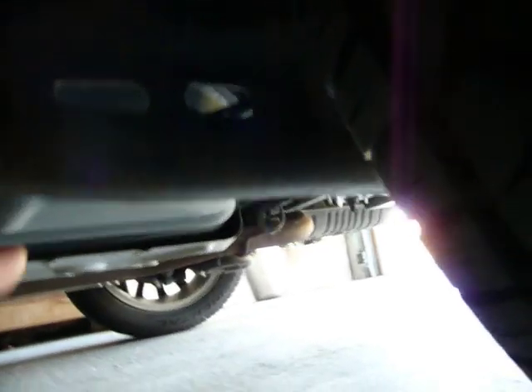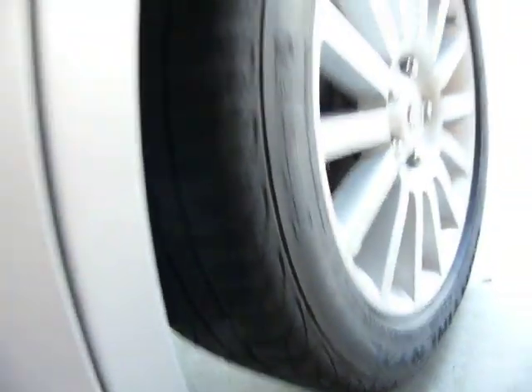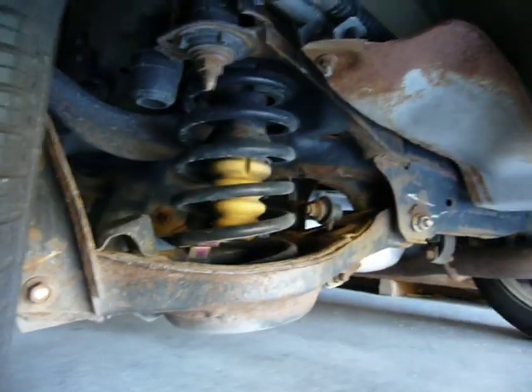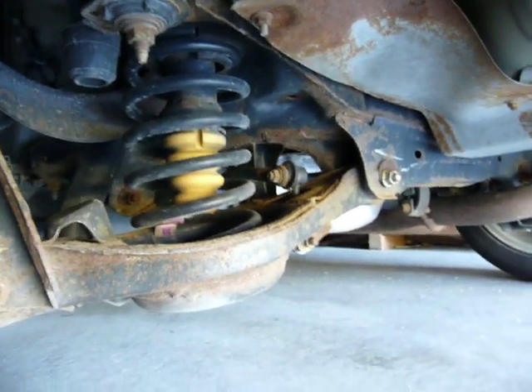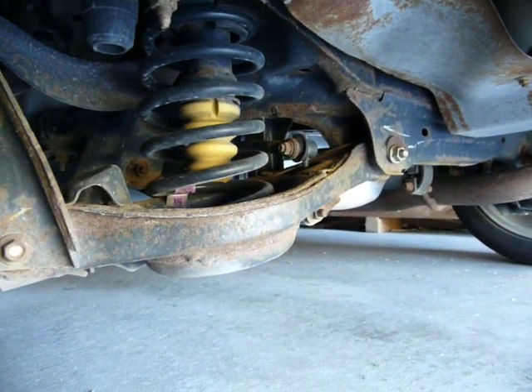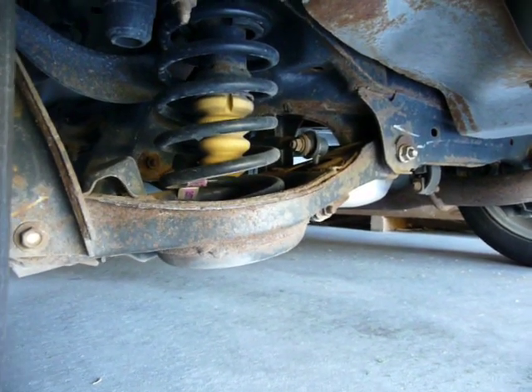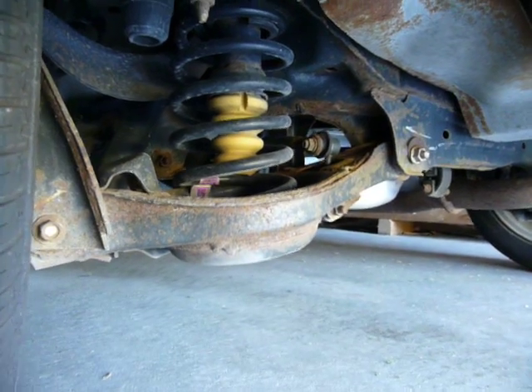This thing right here is actually the control blade. It's a trailing arm, which is mounted to the subframe, which is mounted to the unibody right here. The advantage of this type of suspension is it isolates the ride and handling components in order for engineers to more finely tune it, with increased ride quality over a traditional IRS with the coil-over strut tower, while also maintaining the handling properties.